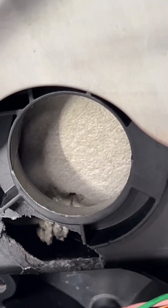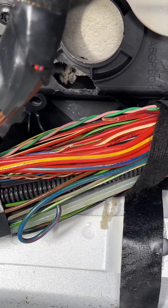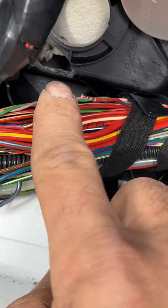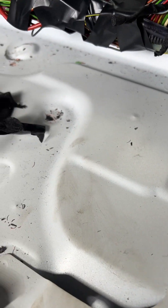And then I kind of seen that hole - I was like, well that's not good, like somebody maybe stabbed a screwdriver or something through it. And I got to looking - here's my five volt reference wire, I'm in the process of fixing it now - but whoever stabbed through that done that. And then I got to looking and I see like strands of copper everywhere, like insulation from wires.